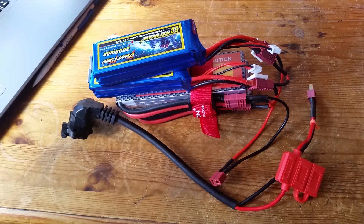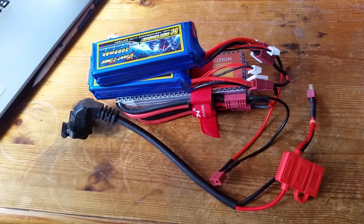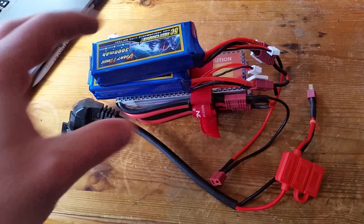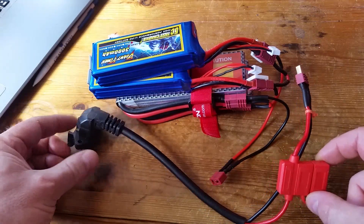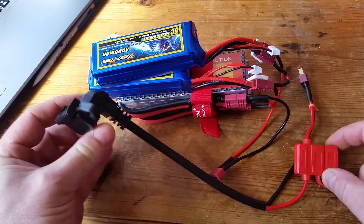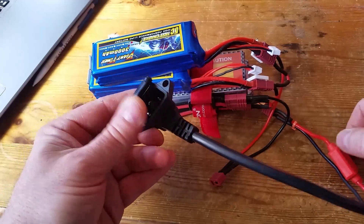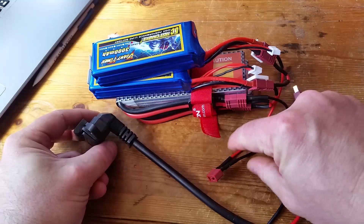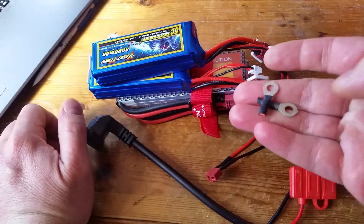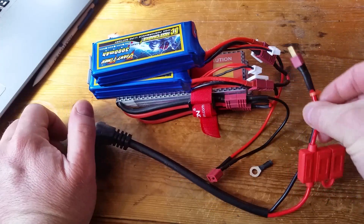Now I've fitted the e-bike kit, I'm going to try it out using these lithium polymer batteries. Each one is normally 11.1 volts but together fully charged they come up to just over 50 volts. Putting batteries like this in series is a bit tricky so it's probably best to have an actual assembled battery pack. The kit came with a connector to connect the battery to the e-bike kit. One thing I don't like is that because it's supplying voltage it should really be a socket rather than a plug. It has a fusing line and I've put a proper battery connector on to connect the series batteries into it.